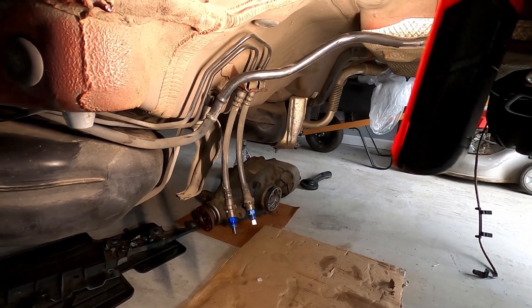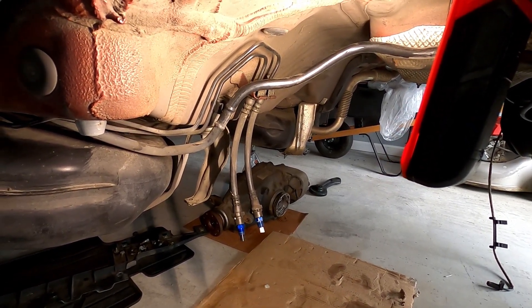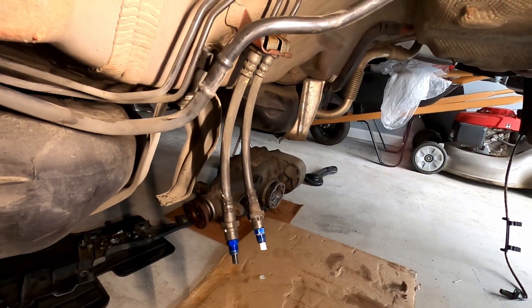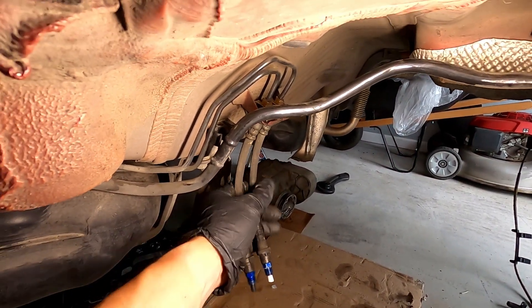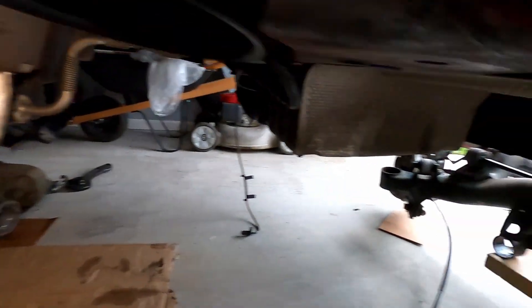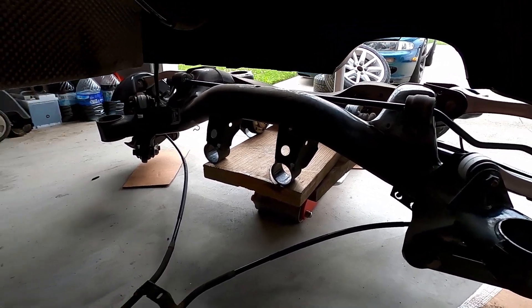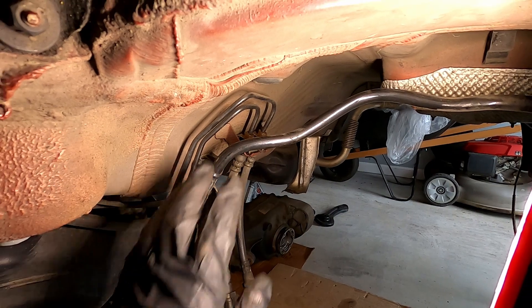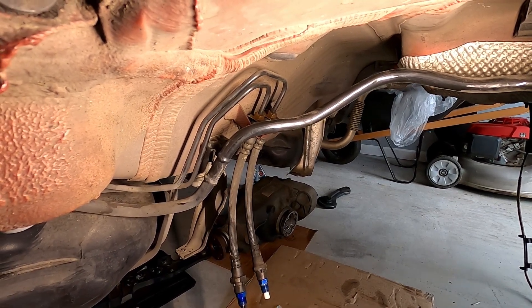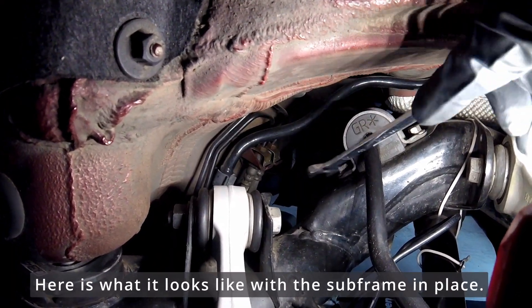Here I am trying to replace these two intermediate brake hoses — that's the extra pair you have to care about if you have this kind of car. The problem is these are difficult to get to because of the subframe that takes up the space. I got the subframe out of the way for a different reason, but to really get to these two you have to make more room than there is when the subframe is installed, if you want to get to these hoses.